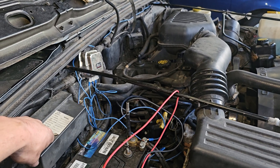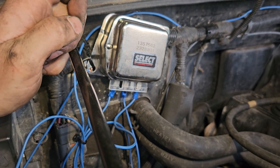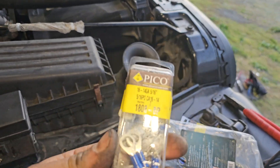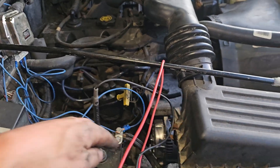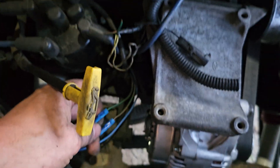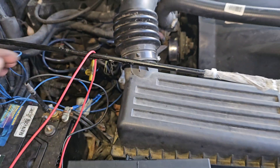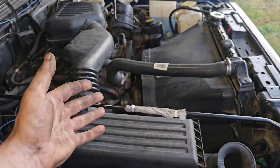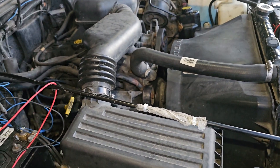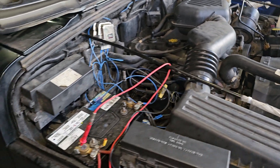That's all there is to it — that's how easy it is to wire one of these external voltage regulators. You can do this for 50 to 100 bucks depending on what you already have. I bought ring terminals to tie onto the battery, and I used butt connectors on the factory field wires rather than running new wire straight through — easy to trace them right off the back of the alternator. If you want to see how to remove the alternator, search 'Go See Rich TJ alternator swap out.' Hope this helped — press like, subscribe for more, and I hope this gets you back running!